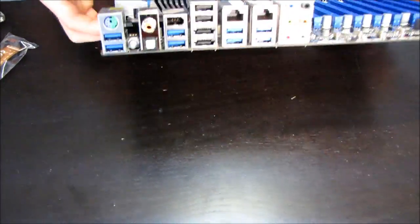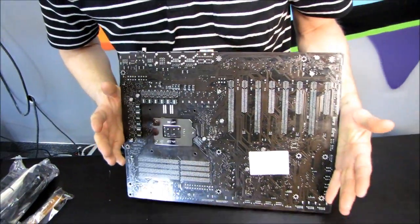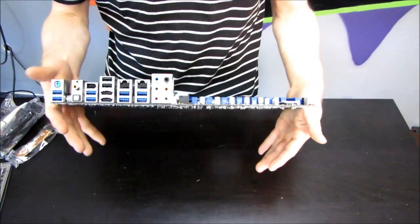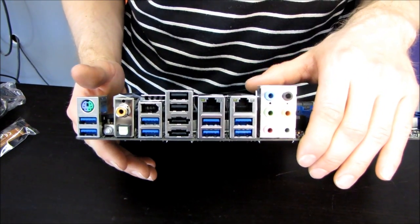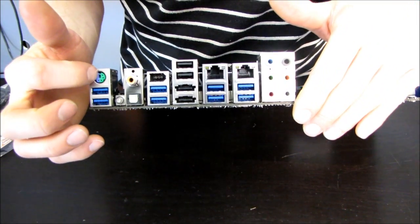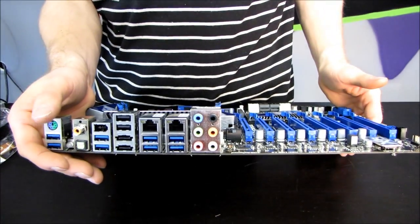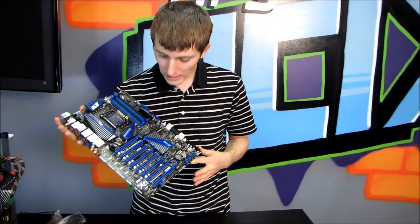That's pretty much everything there is to say about the Big Bang Marshall. On the back you find more power circuitry and your standard back plate. All of the coolers are held on with screws, so you don't have to deal with any push pins — I prefer these spring-loaded screws since they won't get worn out if you take them off and put them back on. On the back, that is eight USB 3.0 ports — this board supports a total of no fewer than 12 USB 3.0 ports. We've got a PS/2 keyboard-mouse combo port, digital audio out in coaxial and optical flavors, Firewire, eSATA times two, gigabit Ethernet times two, and 7.1 audio. Thank you for checking out my unboxing of the MSI Big Bang Marshall. Don't forget to subscribe to Linus Tech Tips for our unboxings, reviews, and other computer videos.